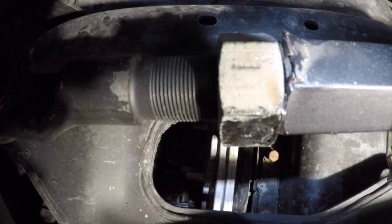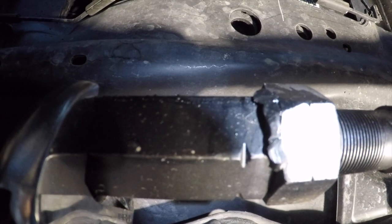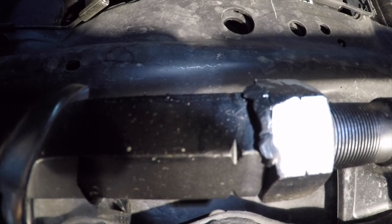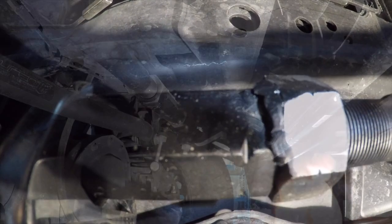You can see the way they welded it — this nut's already loosened, so there's quite a bit of space between the nut and the drag link. Moving over to the passenger side, you can see the weld — it's just a line on one of those platforms. I'm going to use the dremel tool with that little cutting wheel to cut a line just enough to separate the nut from the drag link.